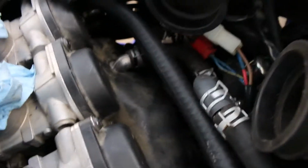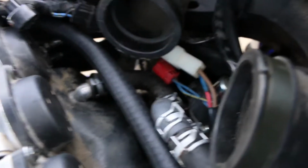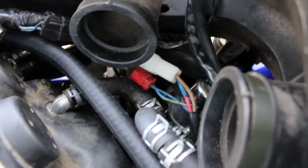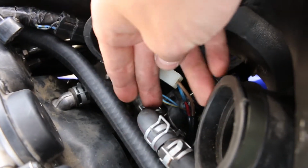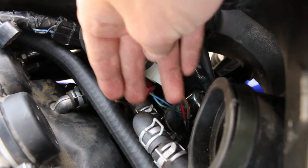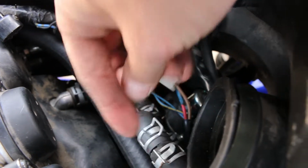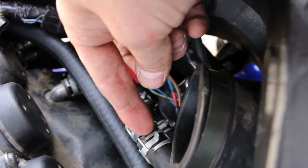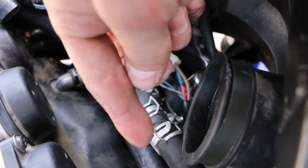Alright, so it's going to be kind of hard to tell because obviously everything is super cramped, but from these valves, the ones that I took off earlier, all we did was run those vent lines to a T. You can see them down there, and then we teed off here. See, teed off here. I used the factory hose that was already 90'd, and then used a straight through piece right here, and then used the supplied heater hose from here on out to the crankcase breather.